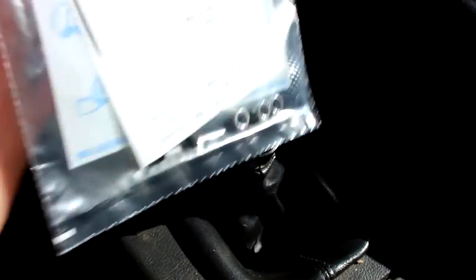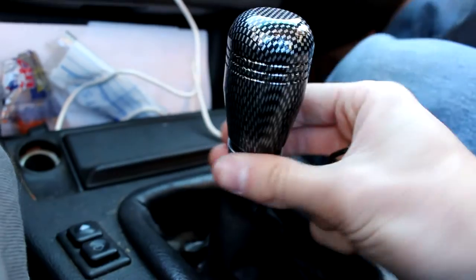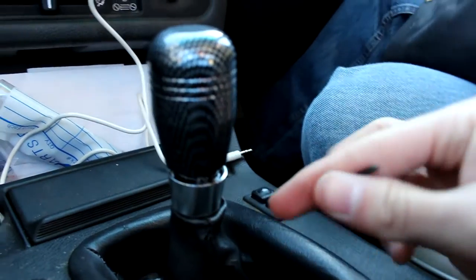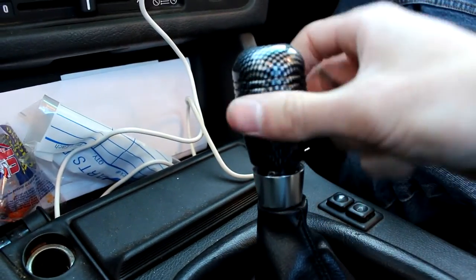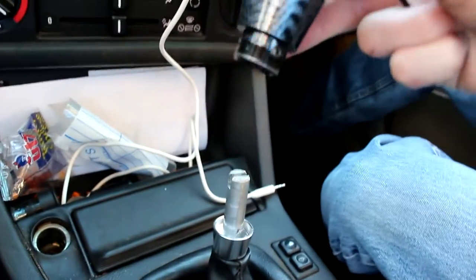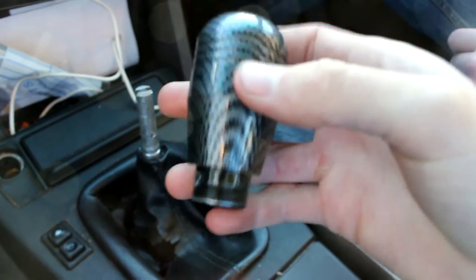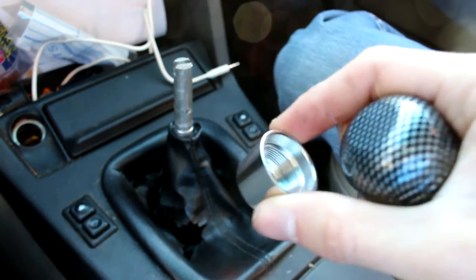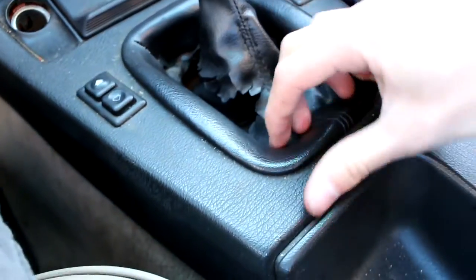Alright, got what we needed here and hopefully we'll make these work better for the shift knob. First step: unscrew this collar. Second step is remove these set screws — this one is a tricky one. I don't even need to remove the second one, it's loose enough. My problem is that the set screws are not going far enough into the shift knob, so because they're sticking out, that little silver collar can't screw on over those hex screws.